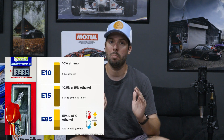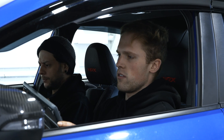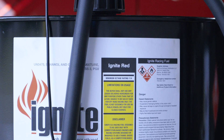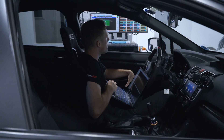The E is just ethanol and the number is the percentage of ethanol concentration in the fuel. Now the car does not actively monitor what ethanol concentration is in your tank or feeding your engine. Just like putting 87 octane in your 91 or 93 car, if it's not actively looking at the fuel concentration and adjusting inputs, this could result in damage to your engine. The car would pull more timing and can induce knock, which can lead to premature wear of the cylinder walls, pistons, and bearings. It's super important to run a similar ethanol content with an ethanol-specific tune. Our tuner Kevin recommends within about 8% of what you're tuning for — so if you have E85, it's probably safe to go down to about E77, but below that you will start to see some issues.